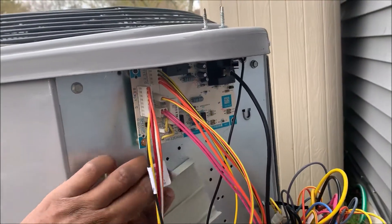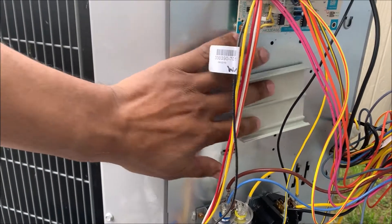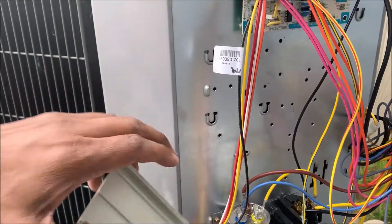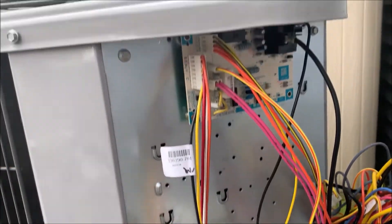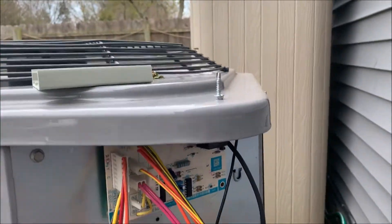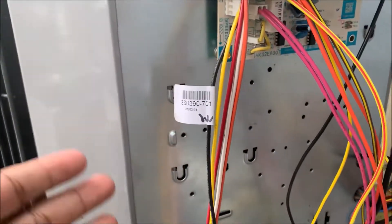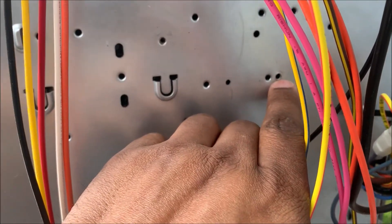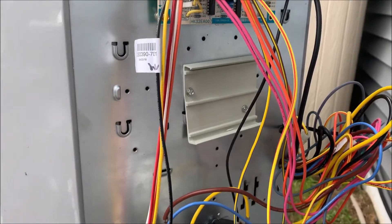When you're looking for a place to mount this — it's like a piece of resin or plastic — make sure that when you put your mounting screws in you're not drilling into a coil and leaking out all your refrigerant, and not drilling into an electrical board, so check behind and make sure the screws aren't going to damage anything. These are the same two self-tapping screws I took off of the start capacitor; I'm just going to reuse them and even reuse the same existing holes so I know I'm not going to drill through anything. It clicks right in.